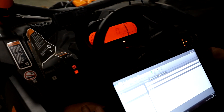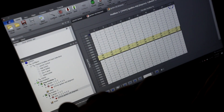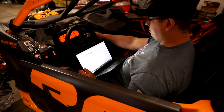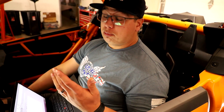If you want to change how the ignition retard works — now that we're at 2500 — you can adjust the axis to a slightly different resolution. So with 2500 as the new point, you'd move these values down to the 2500 area so you're actually getting ignition retard at that RPM, then send it. It'll get a little more violent with the ignition retard. If you don't want aggressive fireballs, you can reduce the ignition retard, but then you won't build as much boost. For six or seven PSI of boost, you need the pops and bangs to get there.